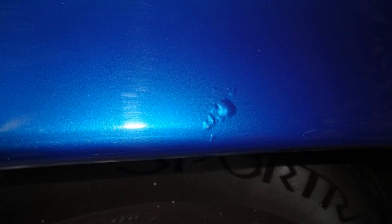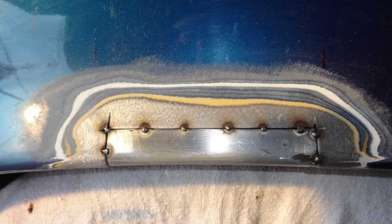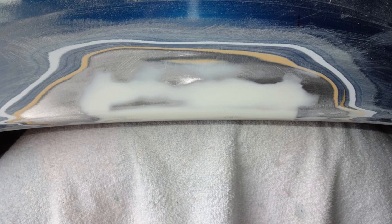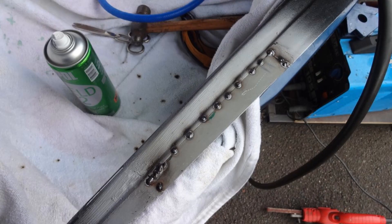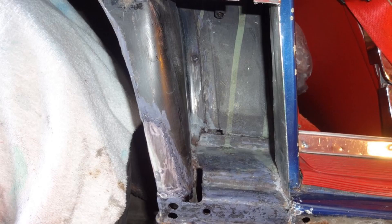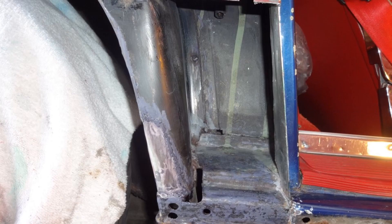More problematic were paint bubbles at the top of the wheel arch. I cut out a section to see what the problem was, then after cleaning up the area, cut out a new section and tacked it in place, then ground and filled. More welding was needed round the boot lid opening — another section tacked in place, grinding done. This area was also perforated — cut out and rust cleaned up. Water from the soft top area drains in here, which is a bad part of the car's design. The area was then painted and a new repair panel let in.